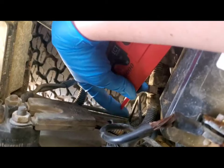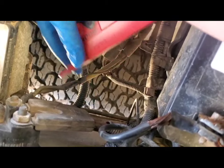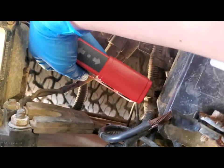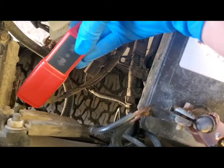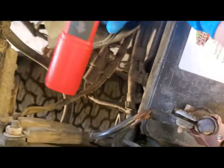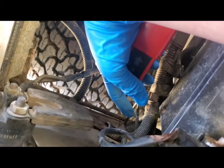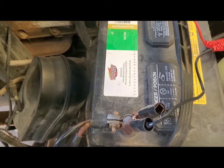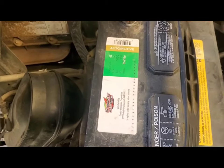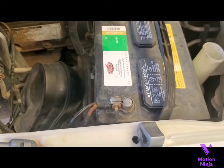Once you've located the area, you can pull the insulation off and put the probe tip between the wires — it'll show you which wire is the shorted one. You can flip it around either way; as long as it's parallel to the wires, the arrow will always point the same direction. I'm going to go ahead, take the insulation off, find my shorted wire, fix it, and that should fix my headlights. If you like this video, please like, subscribe, and comment — thank you so much for watching, we appreciate your views.